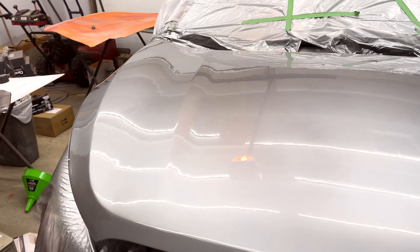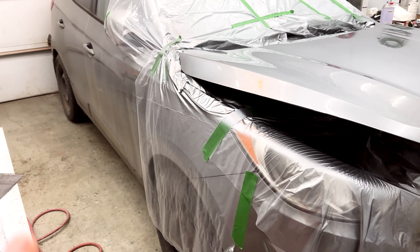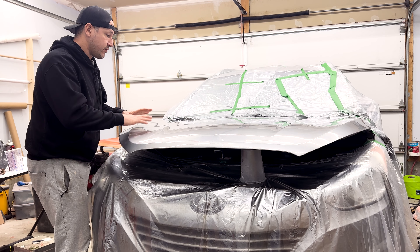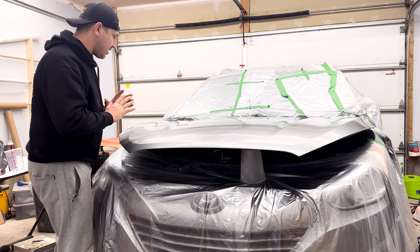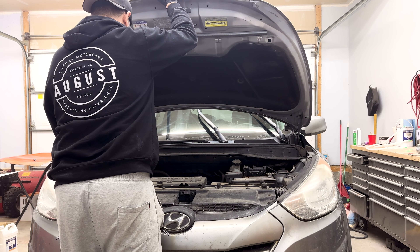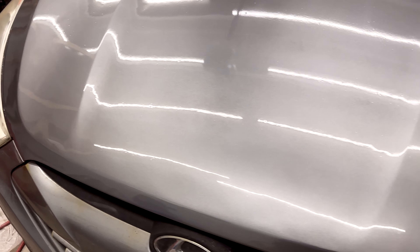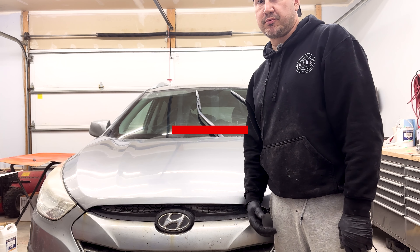Well, that gets us in the right direction. It's pretty good — it's not my best work. We'll take this plastic off and see how close we match it. Okay guys, it's the next day. Everything's cured, nice and dry. There's a couple little dust specs but we can wet sand that out — otherwise it looks really good. Let's get the plastic off and see how the color matches up. It's not bad, I'm happy with that — that's an improvement. Color is pretty dang close. If you were to blend it, it would be spot on. Anyway, that's it guys, thanks for watching — subscribe and we'll check out the next one.